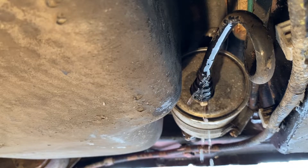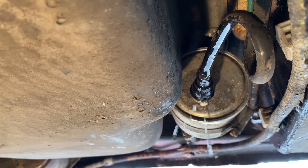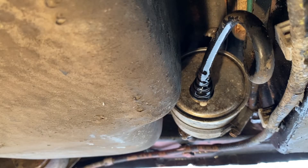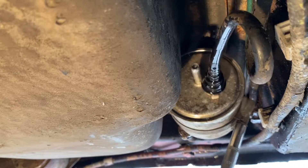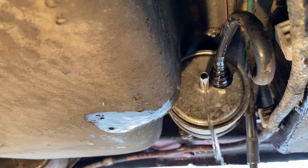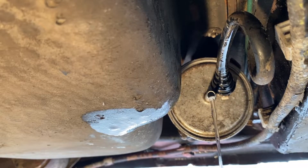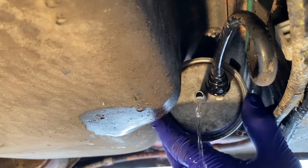We'll wait for that top half of the filter to drain away and then we'll undo the jubilee clip and slide it out. I've emptied my washing bowl of fuel out, that caught it. So that's out of the way now and I'm in a nice dry, fume-free environment. It's just a seven mil on there on the jubilee. Wind the filter free, get the can again, get the tub. There we go, just get it free.